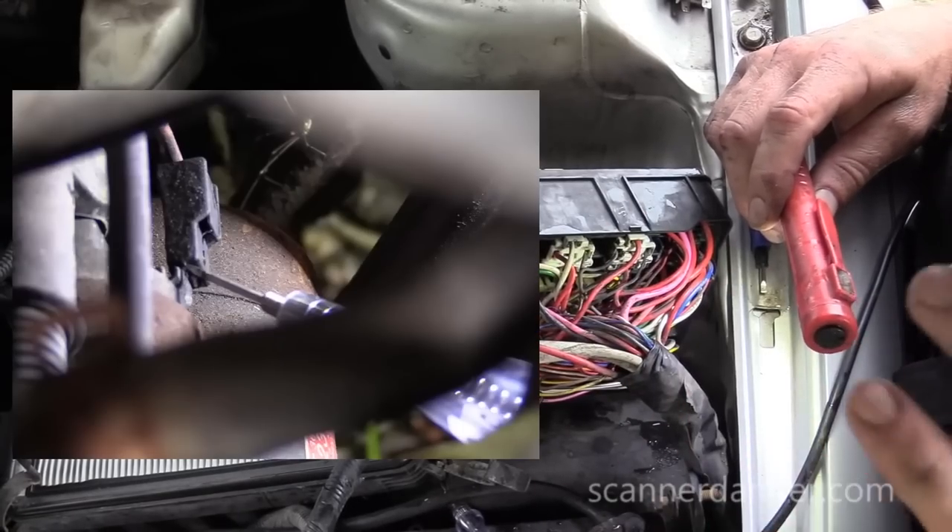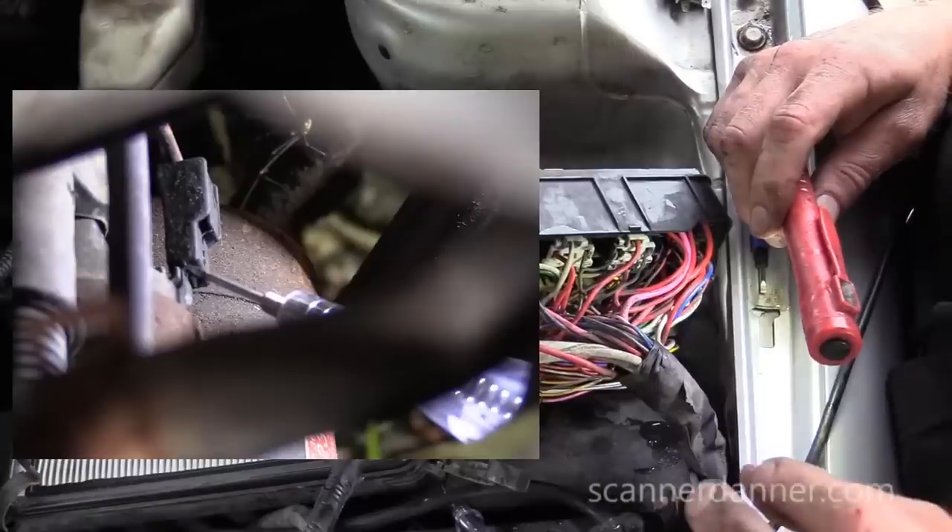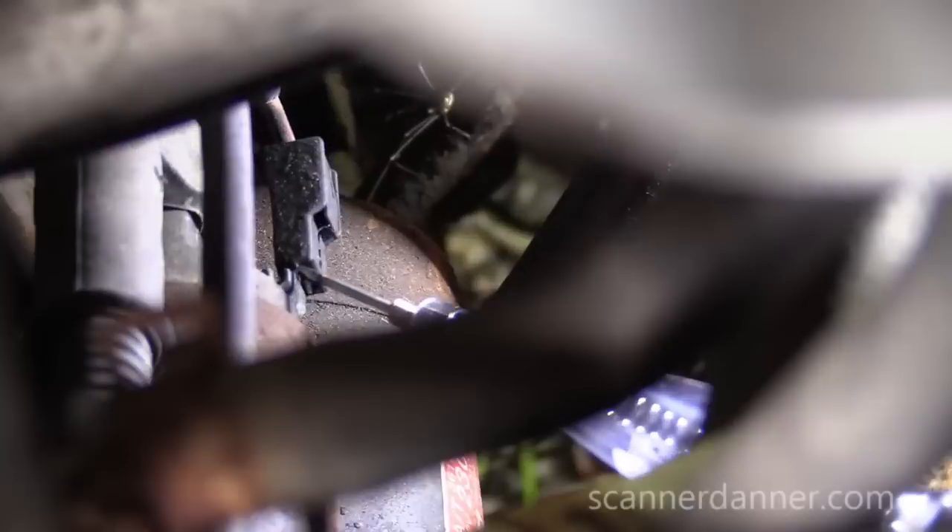At this point I figure out the wiring right there at the S-post is faulty — right at the connection. If I had back-probed that wire I would have found voltage there and might have put a starter in this. This shows again how important it is to check the stud or the terminal first. We had no power at the stud, but on the back side the connector would have been good. This was just a bad connection right at the S-post. You want to go to the end line — don't be satisfied with just a check on the wire.